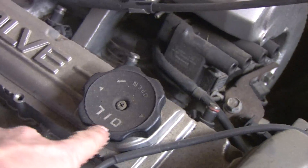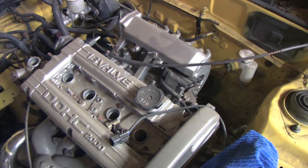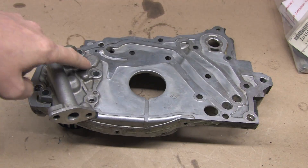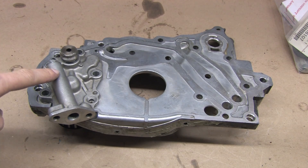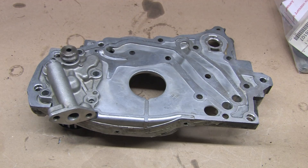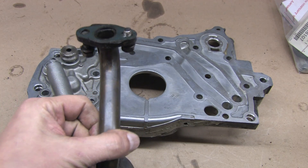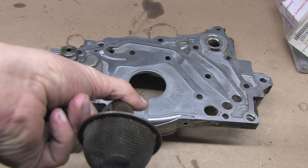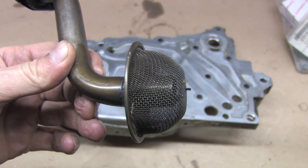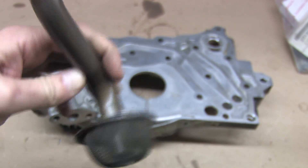Some people know oil goes right here under the 710 cap. Almost as many know they should change it occasionally, but to most, where it flows is a mystery. There are two sides to every pump: a high pressure side and a low pressure side — low pressure in, high pressure out. On a factory DSM oil pump, the low pressure side gets its supply from the oil pan through the oil strainer, so it receives unfiltered oil. Any particles big enough to fit through the oil strainer screen end up in your oil pump gears. This screen is all the filter it gets.